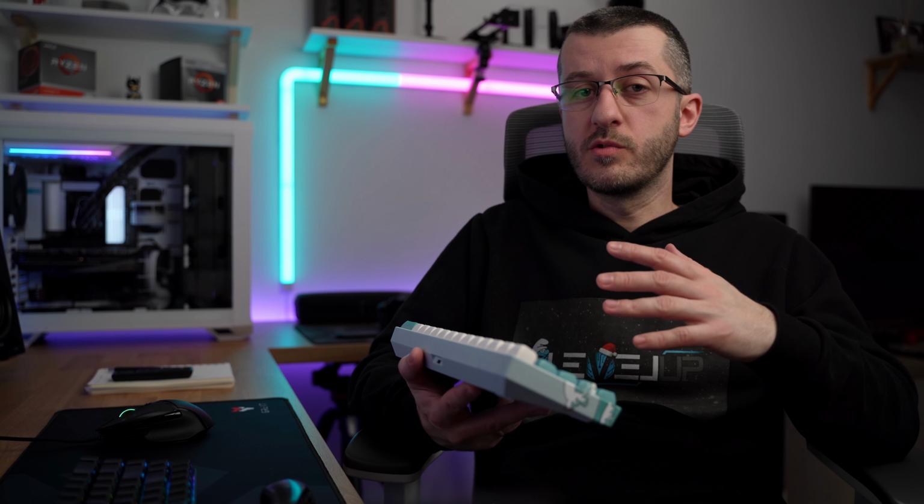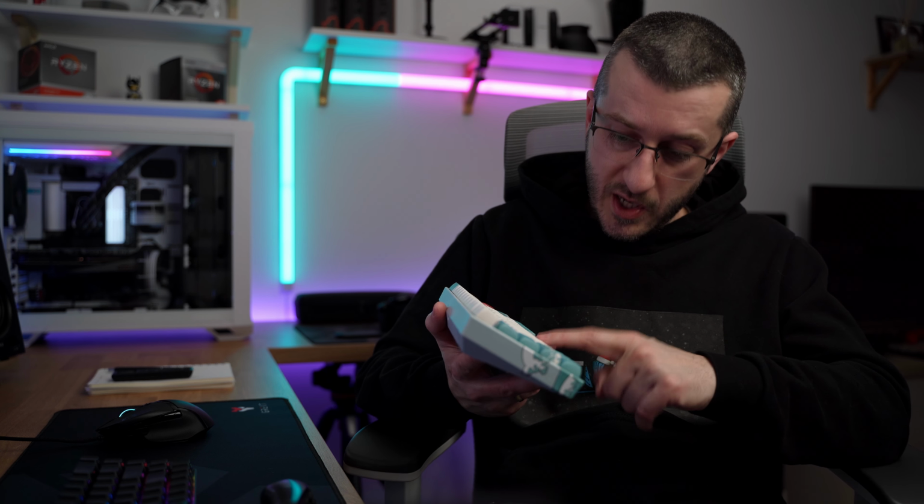So you can hear that hollow sound that case makes, especially when the space bar is punched harder, and actually any larger key for that matter. So foaming it or doing the Tempest tape mod are the easiest ones you can do to this keyboard. The other thing I would recommend is to lubricate the stabilizers. They rattle so much for my taste, but once again, this is an easy fix and it will make it sound much better afterwards. And I'm looking at you, spacebar.